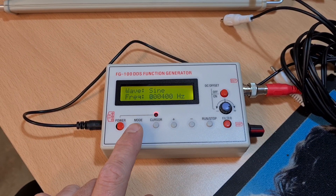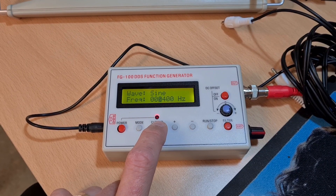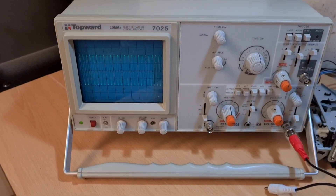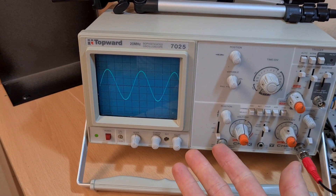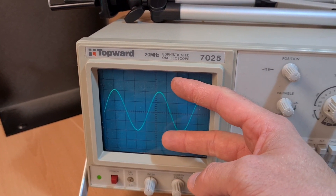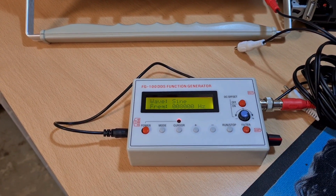The last one I'm going to try is 8,000 Hz, which is the azimuth correction tone that Nakamichi recommends - it's quite high. I'll leave this on sine wave, move the cursor over, and we want 8,000 Hz. Let's try and smooth that out a little bit. There is absolutely nothing wrong with how it's producing that tone and sine wave. It seems to be the same amplitude each time, and there are additional functions like filter on here.